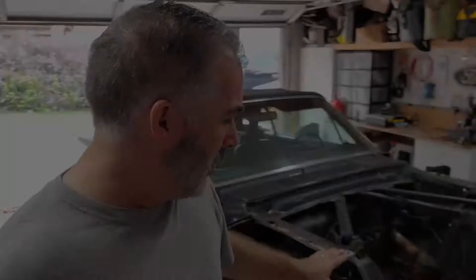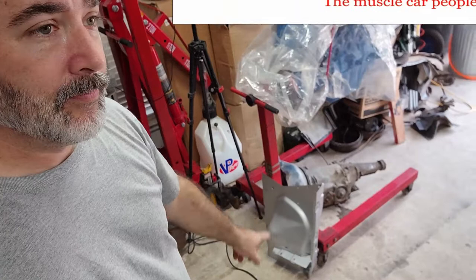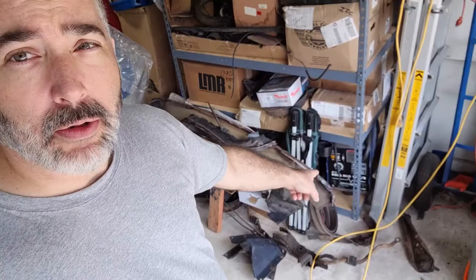Now that I've got this far, I've got it all primed and ready to weld. I don't remember the brand name — I'll have to look and edit — but whatever the brand name is, it's the one that already comes with weld-through primer already on it, so I don't have to worry about that. All of this has been hit with weld-through primer, so I'm ready to go. But I've got a 220-volt MIG welder — it's an old Harbor Freight thing — so it might be too much, and that's the first problem.